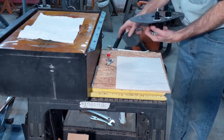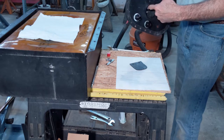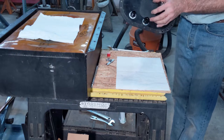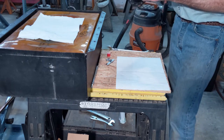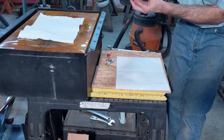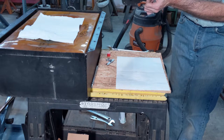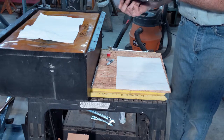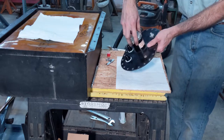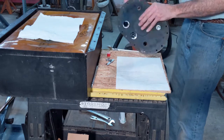Okay, next, so this is the top of the fuel plate, this is the bottom, this is where the fuel goes in and out. I have a flapper valve, which installs on here, and so when the fuel cell's sitting there normally, when you put fuel in or need to dipstick it, the flapper will flop down. But in case of an accident, you flip over, this flapper valve closes, and that keeps fuel from flowing out the cap, say in an accident if the cap gets knocked off.